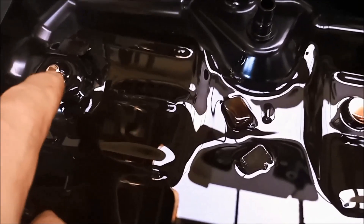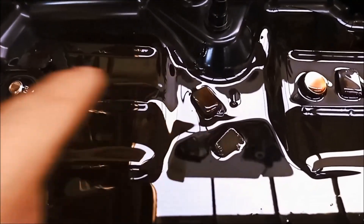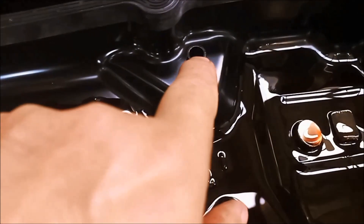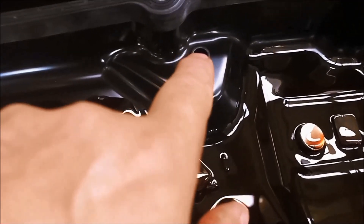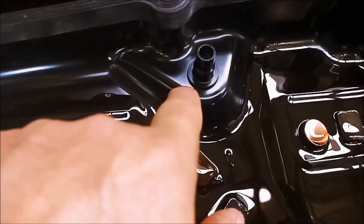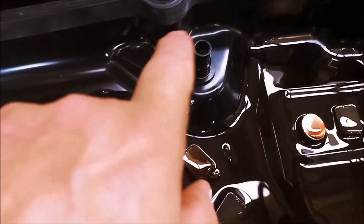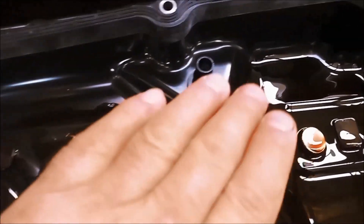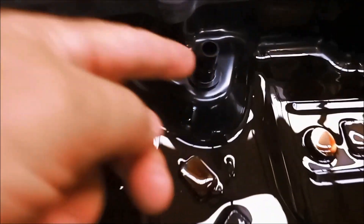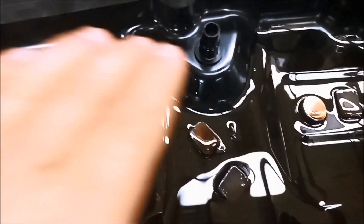Now we've got the drain hole here, and you can see it's up a little bit — that's why there was always that extra little bit of oil in there when you're taking it off. And this other plug here is the fluid level tube. You've got to get the transmission fluid up to a specific temperature — I think it's between 40 and 50 degrees on those — and the oil will just be tipping over the top of that tube. If you have it underfilled or overfilled, it can cause trouble.